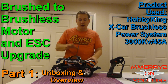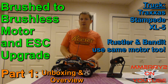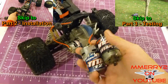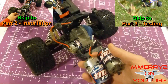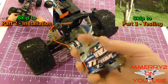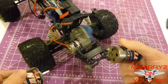It's a brushless motor upgrade. Currently I'm using a brushed motor — this is my Traxxas Stampede XL5. I was having problems with the old motors, constantly having to replace them. They'd overheat, lose power, and fail. I was just throwing my money away. I wanted something that would last, was faster, and that I could run with a two or three cell LiPo — you get more power out of the LiPo battery.